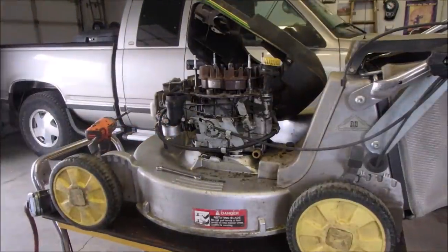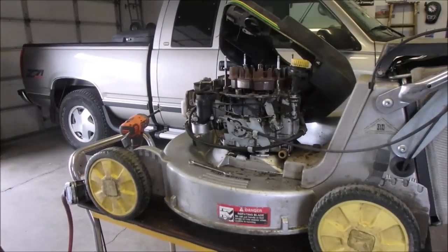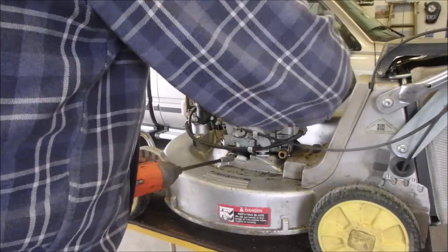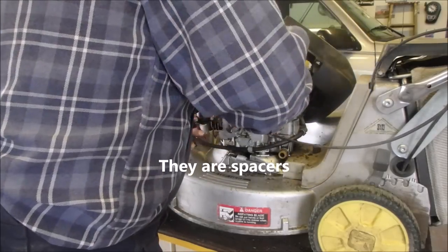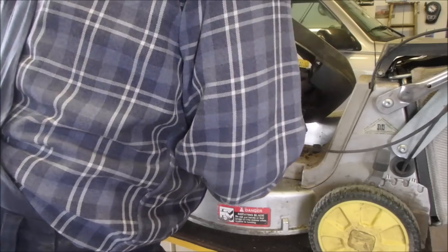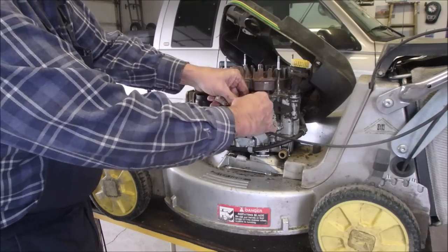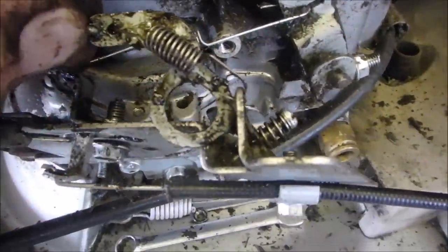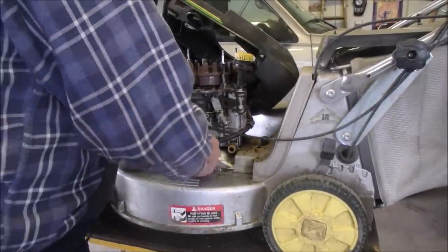I just want to get this back together now. Here's what we got — this 10mm bolt right there, and the nut is on the back. But there's more washers on there than I need, and I found the washers just laying in there, so maybe they were spilled by another guy. I'm going to take that off again and get those washers off. This has got to have a washer inside it so it will rotate. I got this now — it's part of the governor. So now I'm going to put this back together again. It might take me a while, but now I understand how this goes together.